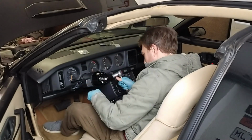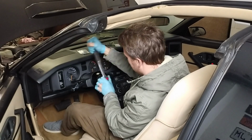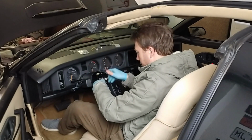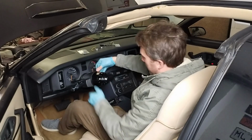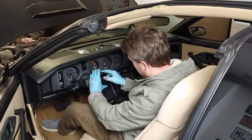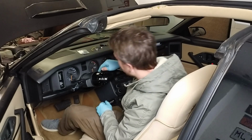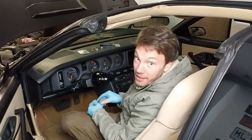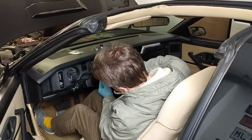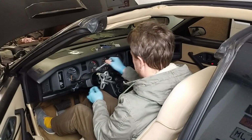Because you can see there's a groove up here. Yeah, you can see there's a bit of a groove here that used to have its place for the airbag electronics in here. Now that I've pressed it in already, I might just take a little knife and trim off the little bits here. I'm afraid I might have to get the steering wheel puller again. So I'm pulling off the steering wheel adapter, so that I can cut off those little ridges inside here that I don't need anymore.